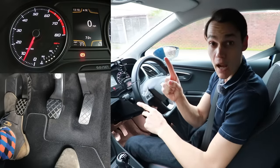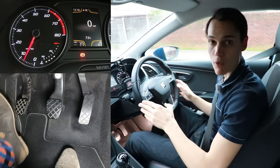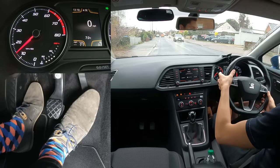There are two things that cause your clutch to wear: one is heat and two is shock. There's also the release bearing, but more on that one later. One way you can help keep your clutch cool is by moving away with less than 2000 RPM of revs.